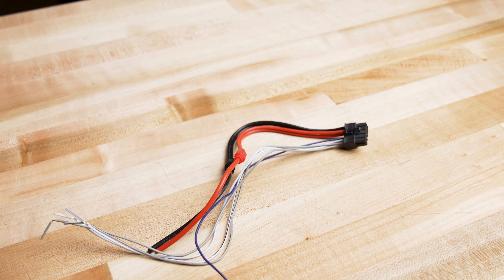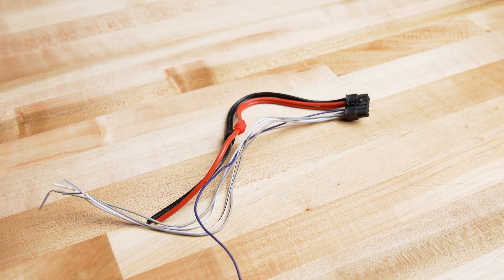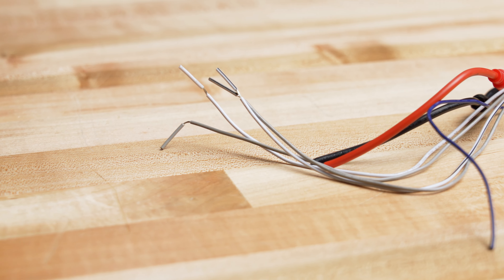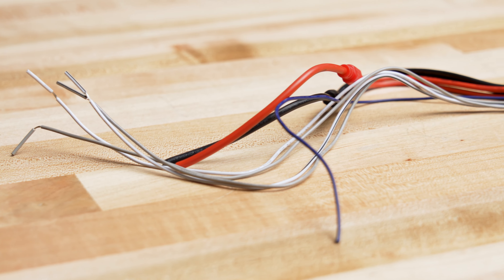The Bass Pro Nano is set up to work with an aftermarket radio that has preamp outputs for an amplifier, like the amplifier inside the Bass Pro Nano, or you can connect it to a factory radio using speaker level inputs. It comes with a harness that has about 12 inches of power wire for power, ground, and remote turn on. These wires are used to connect to the speaker wires in your car — you'll tap into those wires to get a copy of the signal and run it into the Bass Pro Nano. It can use that to make the bass.